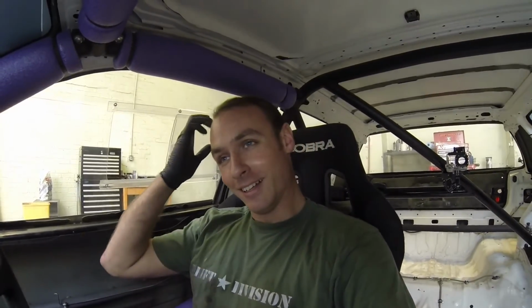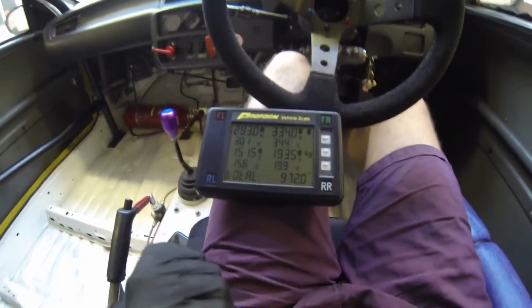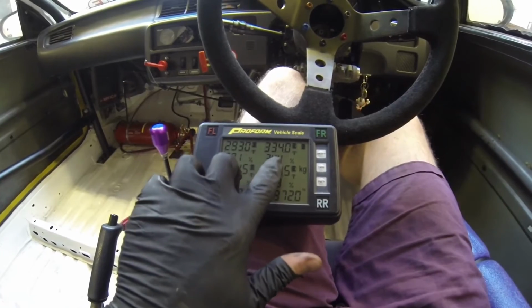Okay, yeah, that was much easier. Just as I said, really. So adjusting each opposite the same, and then sort of matching it with the other opposites. I'm terrible at explaining this, I apologise, but we've got it. So as you can see, what we're after is them cross weights. We want the sum of these two to match the sum of these two.